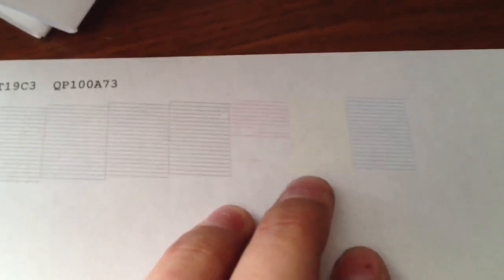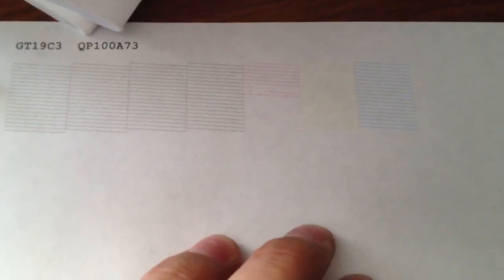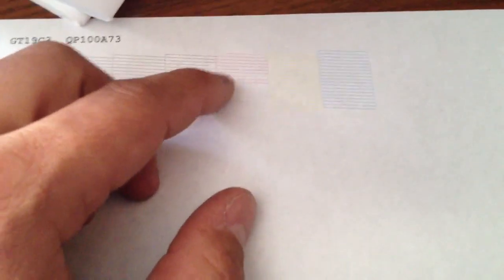One of the issues is you're only supposed to do the head cleaning cycle 4 times at the most, because what could happen is, the pressure lines, when you look inside there, you'll see the little ink lines. Those can rupture from the pump because they're getting clogged, and then you'll leak ink all over the interior. Another problem is that it uses a lot of ink, and if it's clogged, it just bakes on there. It cakes on more and more ink, and then it won't go away. So that's that issue there.